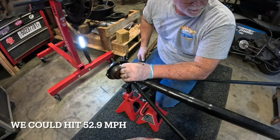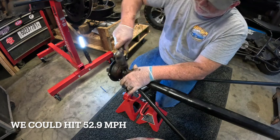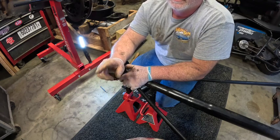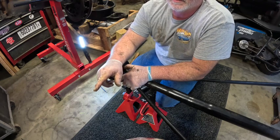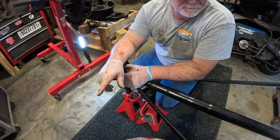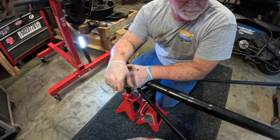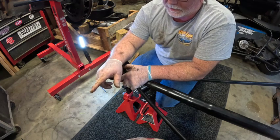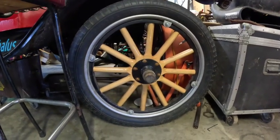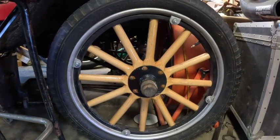This is also a 3-to-1 ratio rear end that we used on the coast-to-coast for hydrocephalus trip. I think we have a 260 or 270 lift cam, regrind, Scat crankshaft, stock head, 60 over pistons, 26, 27 transmission, and Rocky Mountain brakes. Man, this thing was great. Dave Stoller built us these wheels, man. Look at those things. You probably won't see anything prettier than that today. Unless you see my wife.